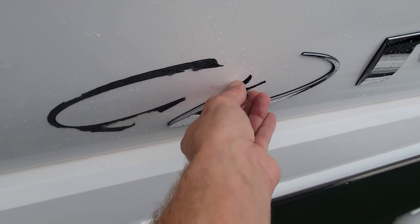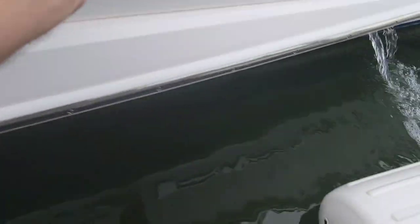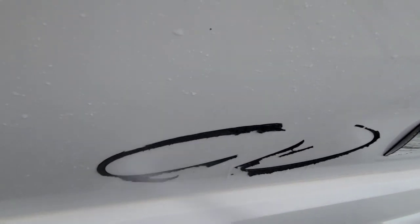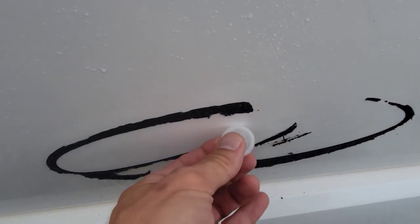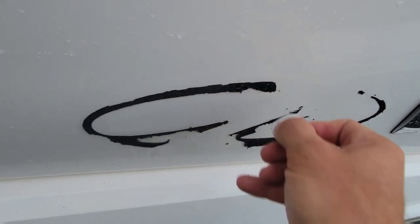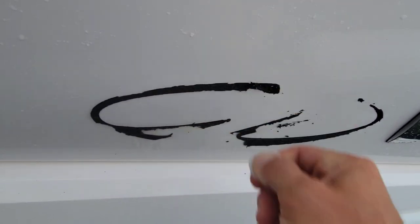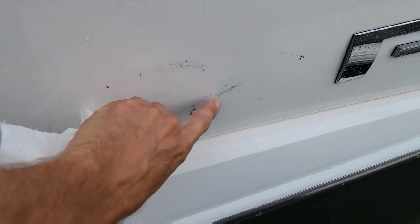It looks like it's metal but it's actually plastic. I think they do that because if it was metal it would corrode. Now we're floating away. I'll spray a little cleaner on it, let it soak in - it'll help release that adhesive. Before I put a razor blade on this, if it doesn't want to come off, just take a bottle cap - anything plastic, it's not abrasive, it's not gonna hurt the gel coat. See if we can just scrape this off first. That seems to work pretty good. Ten minutes later we got most of it off; you still see the glue. I'm gonna spray this again and get the rest cleaned off.